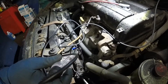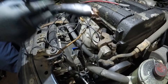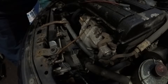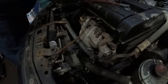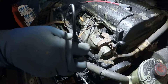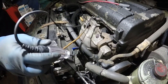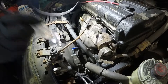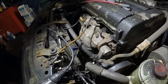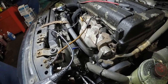I'll take this over to the battery and put this end to the battery on the positive. I got that side on positive. Now I'm going to check the ground — see that, it has ground. So this fan motor has power and ground but the fan does not come on. That's a complete signal — this fan motor has gone bad, so we're going to replace it.